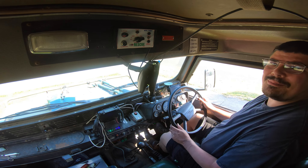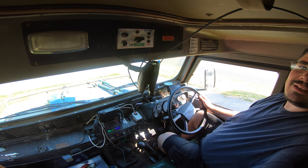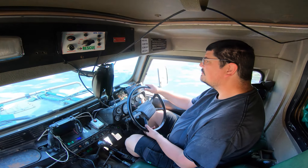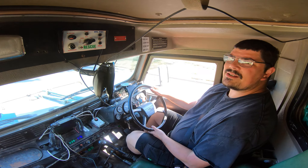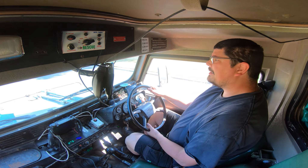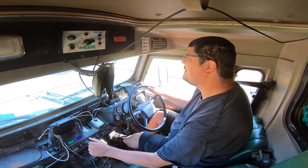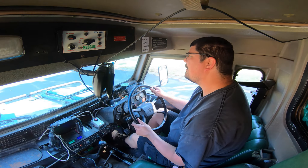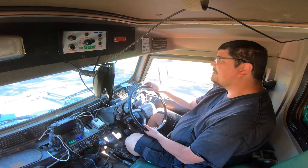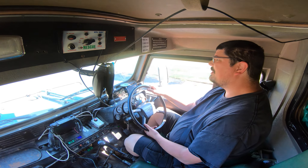I think it's ever stopped that good. I'm going to take it around to the mechanic, have a chat, and then we'll take it for a test drive. We're in a service road, pretty safe, nobody around behind. Brakes - okay, I had to pump that. Yeah, there's probably air in the system somewhere. We're going to re-bleed the brakes, but definitely the master cylinder was part of it.